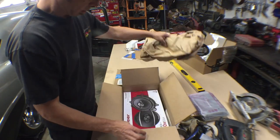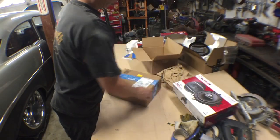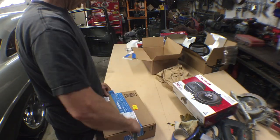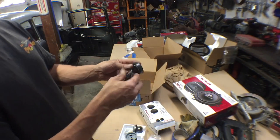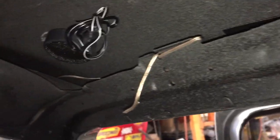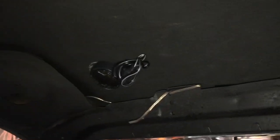It's wrapped up nice — 6 and a half inch, there's a front, that's nice. This feels pretty light so these might be our tweeters. These are our tweeters, they're nice and small, and I'll show you where we're going to put these real quick. We're going to hide them up in here just underneath the headliner, probably glue them up there, and the wires are already run. It's always hard to get the sound up high — we usually put the speakers down low in the kick panels or in the center console — so I think this will help.